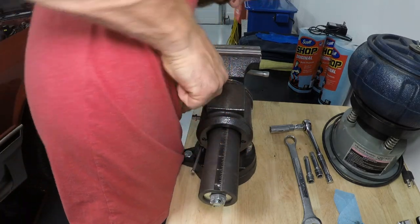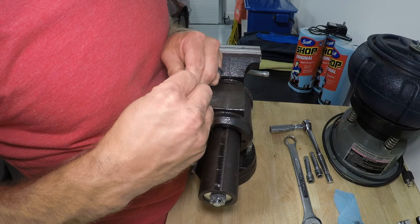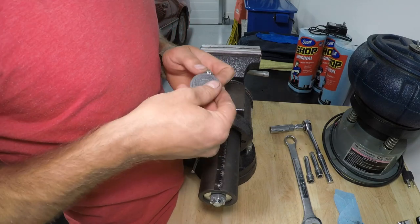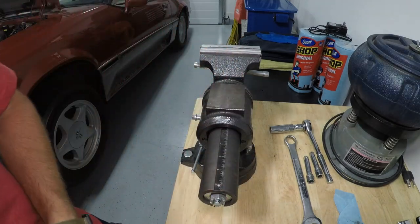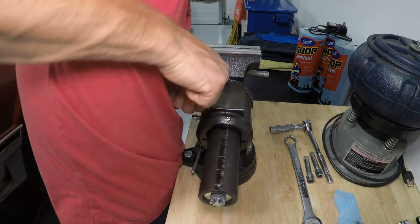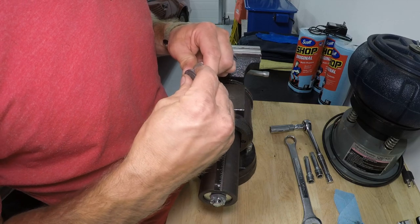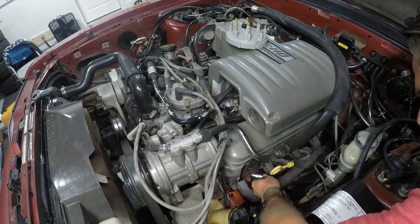The gap's too big again — going to push down on that plug and close the gap in a bit. Here I actually closed the gap too much, so you can use that hole inside of the plug gap tool to open the gap back up. I obviously overdid it, so here I am checking it again. It's a little bit of finesse — you go back and forth. Sometimes you close it too much, sometimes you open it up too much, but at the end of the day you just want your plug gap within Ford's recommended specifications.